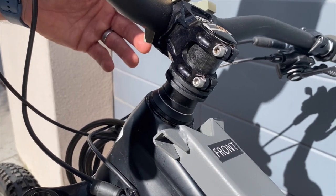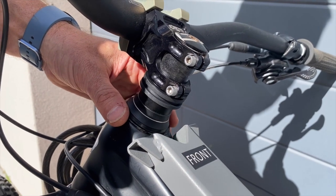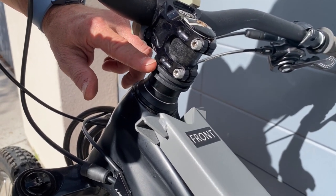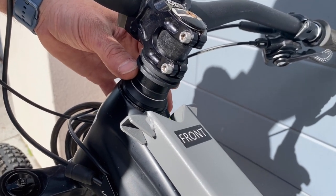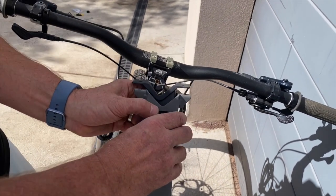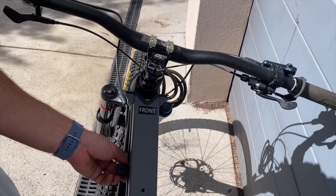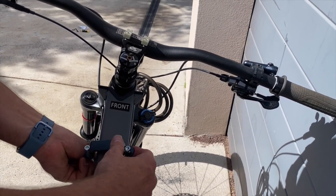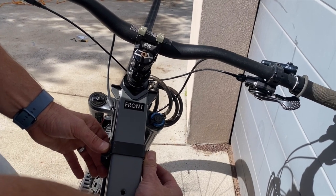We've shown you how our seat fits normally to most bikes. If there's an oversized top tube or no space under the stem at the headset, we use our stem adapter — but you need 20 millimeters of spacer and then our stem adapter on top for that to work. On some bikes the stem is cut and you can't raise the bars at all. In that case we have a top tube adapter. Remove the front bracket and add our paint protector, then take the front bracket and move it underneath the bar to change the attachment. Add the bolts and the top bracket, tighten that up, and that is how the top tube adapter works.